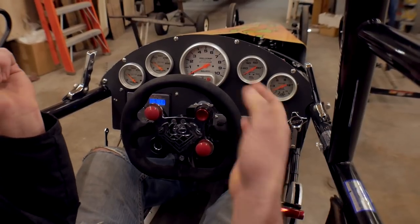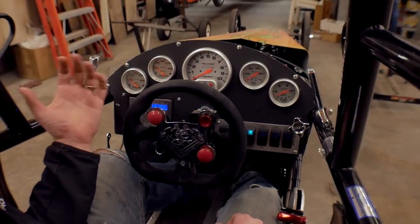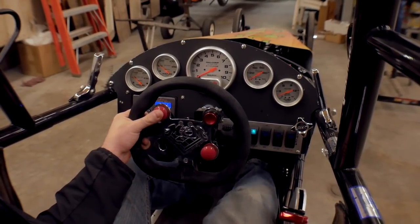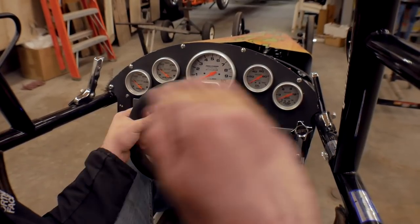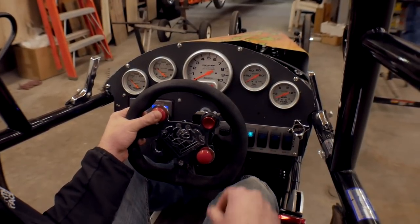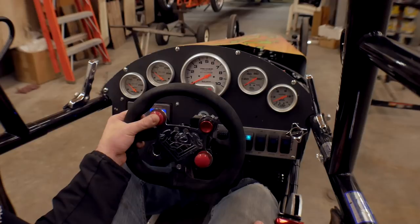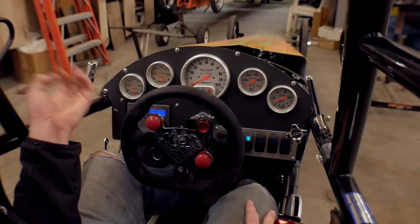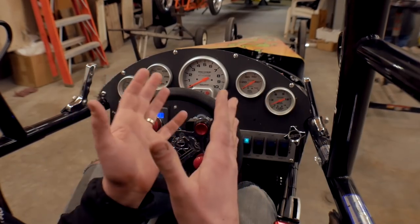I will shift up into high gear — this right here is the rev limiter for my burnout. I'll go ahead and click that button down, hold it down, roll the car forward in high gear, stomp on the throttle, do the burnout, and let off nice and easy. We don't want to trip the tires — that's going to put a nice glazing on the tire and it's actually going to hinder your traction on the starting line. So we like to let off of the throttle nice and easy and try to minimize that chirp sound that happens right at the end of the burnout. Ease off the throttle, come out of the burnout, let go of the burnout button, and hit the brake pedal and stop the car.